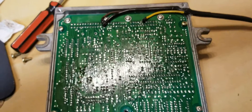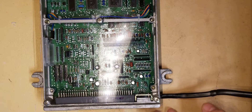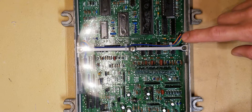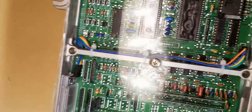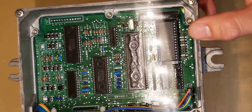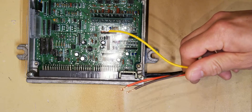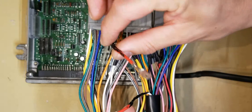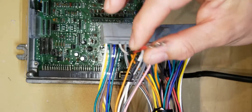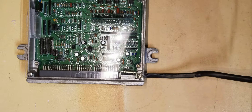Okay, so let's recap on everything we went through up until now. We have installed the data logging capability to a Bluetooth FTDI and routed the cable around the case. We have chipped the ECU. And depending on how you want to run your wideband: if you followed my instructions you will have a self-contained ECU with the wideband function, or if you go into the car on your harness side you would cut D14 and use the end on the connector side as your input for your O2 sensor. Either way will work — it's really up to you. Stay tuned for the next installments on Honda Tuning 101. Thanks for watching, please subscribe.